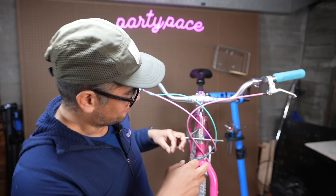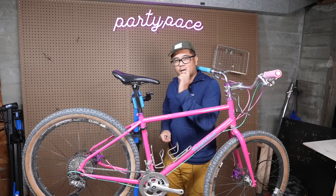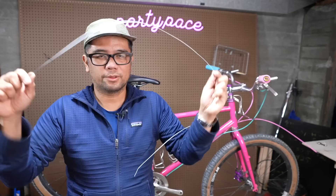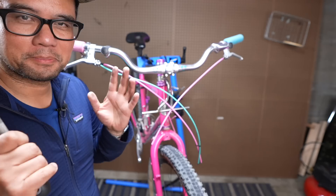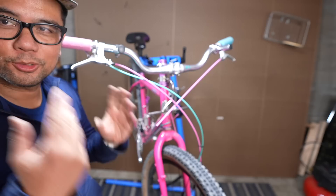First thing I'm going to do is pull out the inner steel cable, figure out where I want to cut the housing, and then reattach it with this handlebar setup to make sure everything is shifting okay. I'm going to undo the rear brake first, then the rear derailleur. I don't have to mess with the front derailleur on this bike because I've got a funky seat-mounted front derailleur. All right, the cables are free — front brake out, rear brake out, rear shifter. I just realized I cut the cables without actually filming it. Apologies. I decided to cut it near the base, near the crown of the bike, which will accommodate the different cable run of a drop bar.